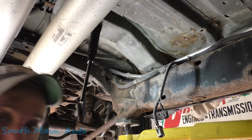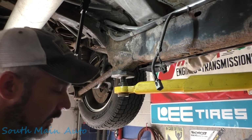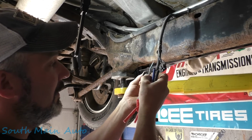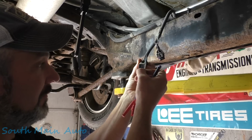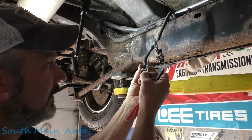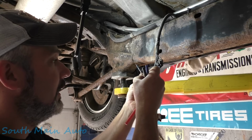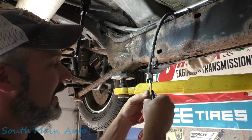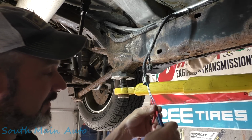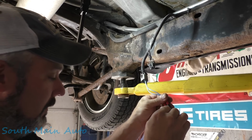I'm gonna see if I can pull that up on scan data for us. So I've got us a couple probes here. I went through just to make sure pin fitment was good, and we have good pin fitment on each one. What we're gonna do is put a variable resistor across the fuel level sensor side and the ground. Right now on scan data, it's at 100% fuel.